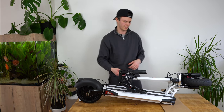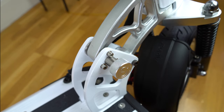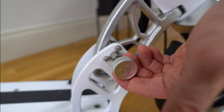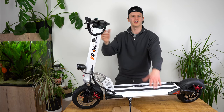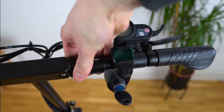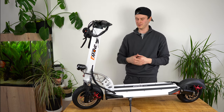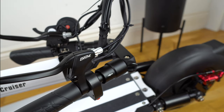Let's pop the stem up and lock it into place. The actual folding mechanism itself is really simple — you can see there's a safety pin that punches through both of the holes. To fold this, bring it up and leverage the scooter into you so you can push the safety pin through. I've moved the scooter around slightly so you can get a better view. Pull on the handlebars and fold it down until it clicks below the mechanism that holds it into place, which makes storage more compact — because the cruiser is not a small scooter.